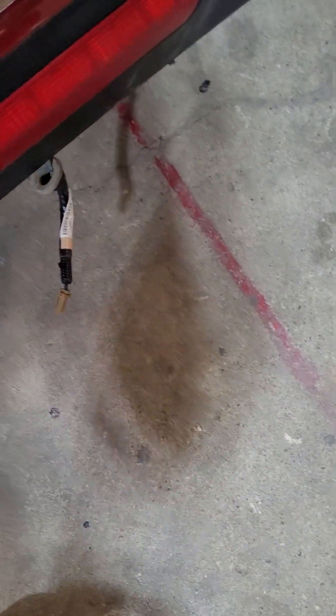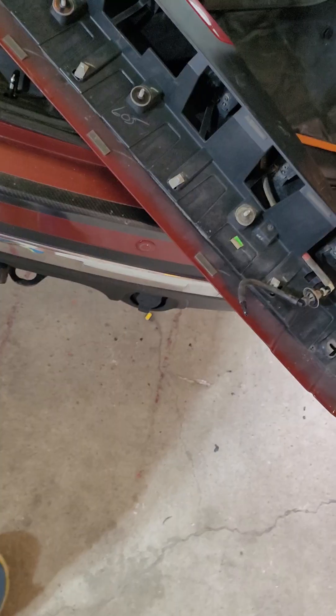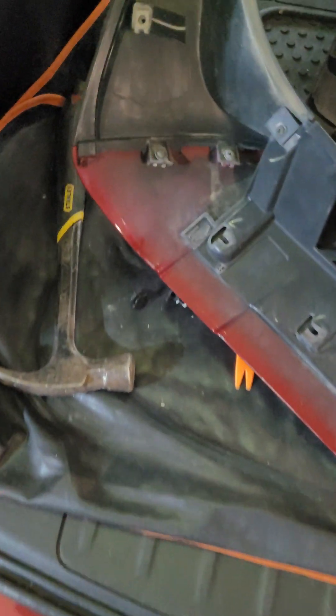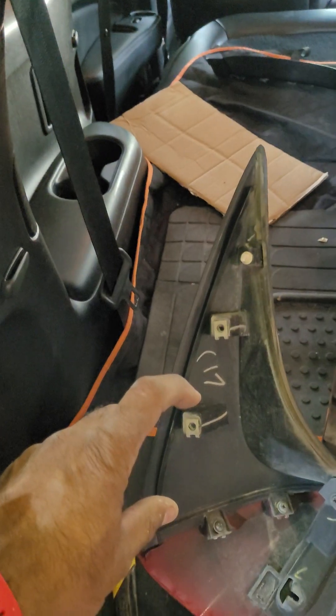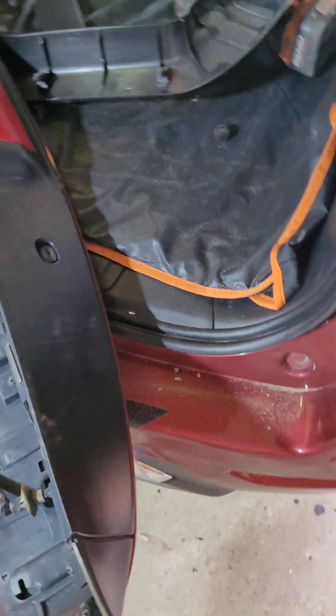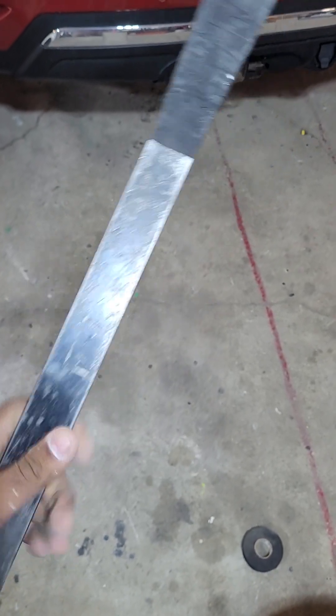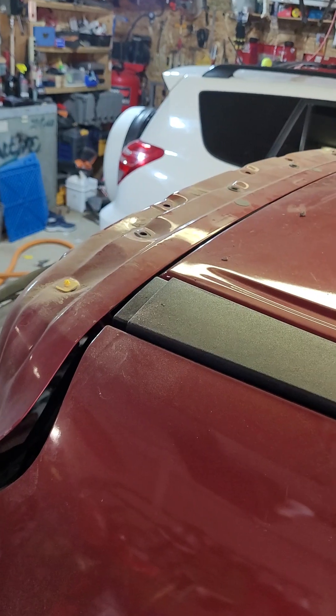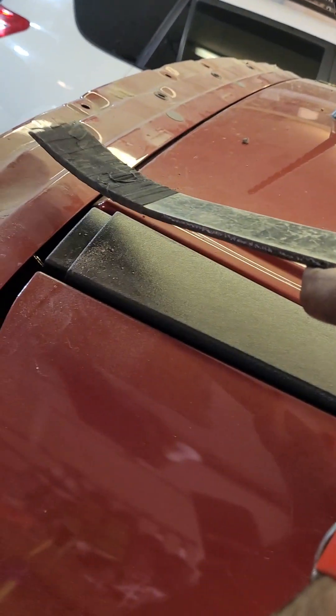The spoiler does come off but it is a royal pain in the butt. Just about every single one of my clips either broke or came awfully close to breaking, so you will need to have new clips in place when you go to put it back on. I used a pry bar wrapped with tape at the end so I wouldn't scratch it, and from up here I was able to wedge in underneath and pop along all the way from both sides.